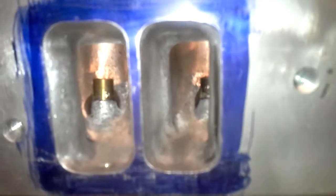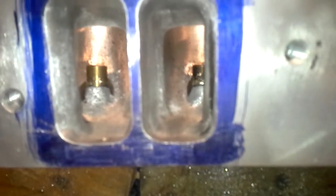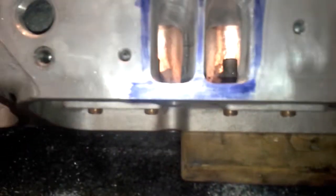That pushrod wall is pretty much done on the left but not on the right — you can see that crazy dip they put in. You can also see the floors. When you look at the transition on a floor, you want to straighten out the roof, because the height of your roof is not going to be a detriment — you want that air to be flying through there as fast as possible. If you look at one I haven't worked much, it has like a ski jump: it comes from the port and jumps up toward the head. So I flatten all that out and give it a much better transition so the air doesn't run into any problems.